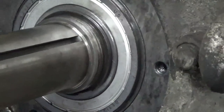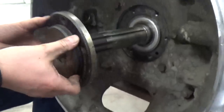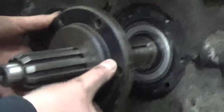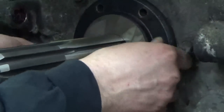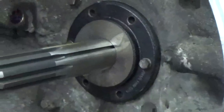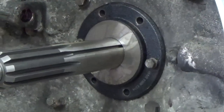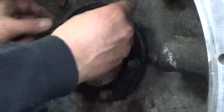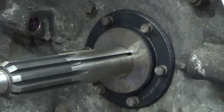Once you've got that, you're ready to put this on — make sure that your oil hole is lined up here. I believe that's an oil drain-back hole. Pop that back on. When you put your bolts in, make sure you pop some blue Loctite on them. Then we can torque them down, and the next thing will be to put the fork back in.